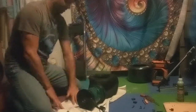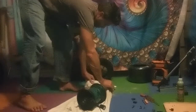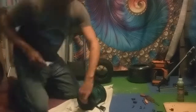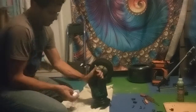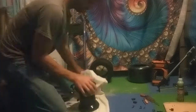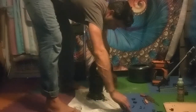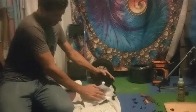Tire's off. Now I've got a lot of slime — make sure you're on a rag because that slime just sucks. I get a little rag and wipe off all this green stuff. You don't really have to replace the green slime, but you might as well, especially if you're running on asphalt because you're going to pick up a tack and it's good to have that seal in there. Clean up the old stuff, polish it the best you can, and wipe it down nice and neat with some paper towels.